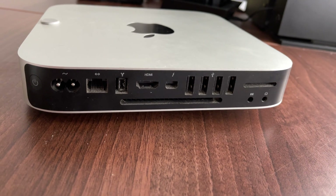So what you'll see shortly is not something I'd condone or recommend, but because it was someone else's Mac I wanted to take a lot more care over it than usual. What I ended up doing was simply give it a little bit of a tap with the end of the screwdriver. I think you can probably see I was getting a little bit agitated with it. The problem with these two screws in particular is that there are only two or three bits of thread on them, and what I've done in the past is rip the thread off the screw — and then unfortunately the base doesn't sit properly when you put it back on. So it's really important to get those screws on properly.